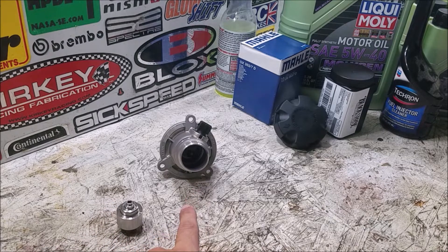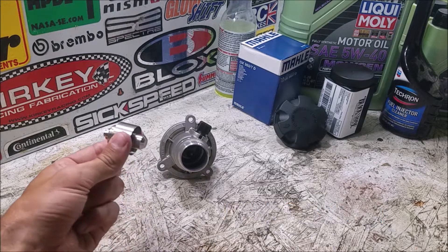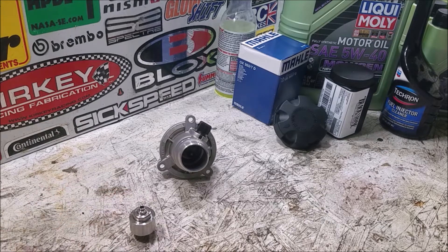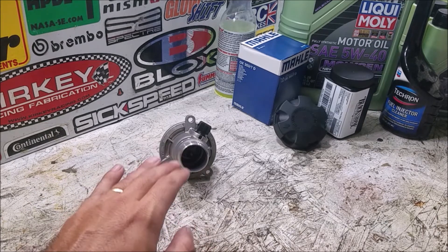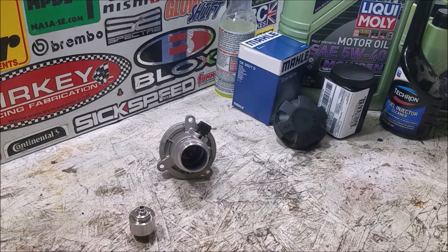These are the two objects that govern the temperature of your oil and your coolant, so by dropping them both down at the same time they're going to work together instead of against each other. Both are from N63 Intake and are extremely high quality. The oil cooler valve is made from a solid chunk of titanium milled down to factory spec, and the thermostat is a BMW factory thermostat modified to open at a lower 80 degrees Celsius.